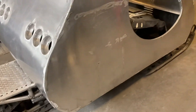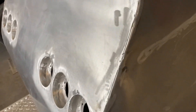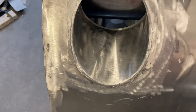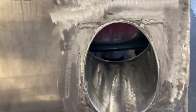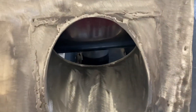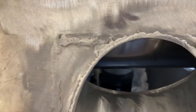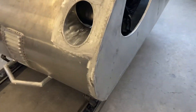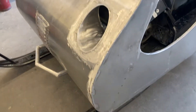Like I said, it's coming along and I'm going to start doing some filler work now — all around these edges here where I did my welds, all around the tail lights, smoothing it all out, around the dash, and around the front headlights. I cut the older ones out there — a bit of a butcher job as you can see. I used the spool gun, which works just like a MIG welder, same sort of deal. I just did some tack welds beside each other really fast and joined it all up and ground it down. I'll put dyna glass on there first all around my welds, and then some filler work over top of that.